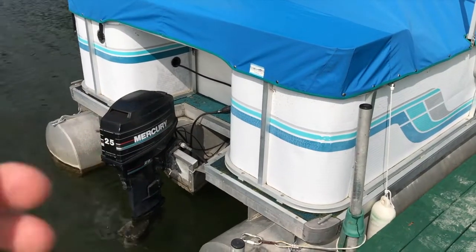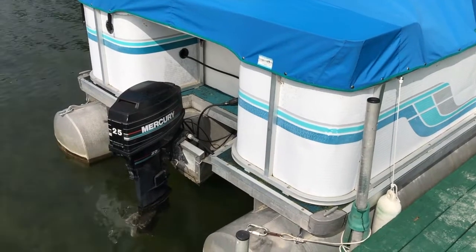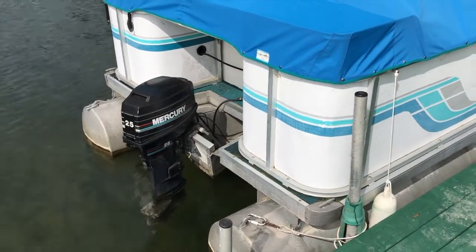Hey YouTubers, Mike Boards with the Mike Boards channel. Thank you for watching. This past weekend, just a regular Saturday afternoon out for a boat ride, and all of a sudden the engine starts bogging down and shaking. We pop the cap off and find that one of the spark plugs blew completely out of the cylinder. That means the internal thread of the cylinder is completely ruined and no longer capable of holding that spark plug in place. Now we got to fix it — pretty friendly DIY project. Let's get started. We're at the back of the boat and the 25 horsepower Mercury outboard two-stroke engine is what we're going to be working on today.